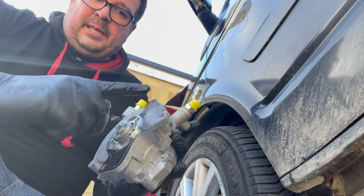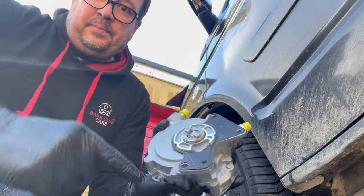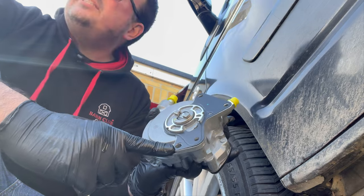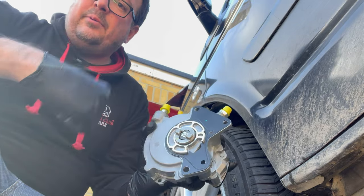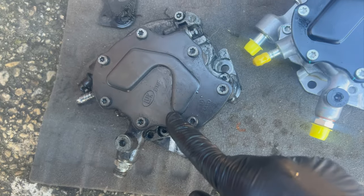This comes with a new metal gasket, and there are three bolt holes — two up top and one down below — so we need to look on the pump to track these down in the engine bay. The top two are T40, and the last one is a 10mm right at the bottom, so I'm going to have to get my torch out and have a look for it. With those three bolts out, you've got the pump.